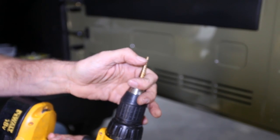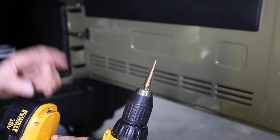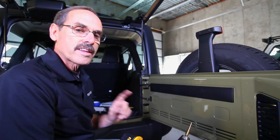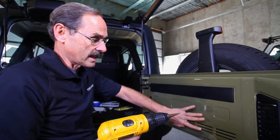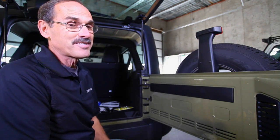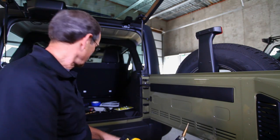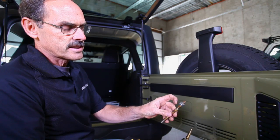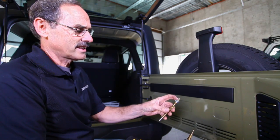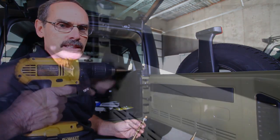Next up we'll drill our pilot holes for the nutserts. I'm just going to use a step bit that will give me about an eighth inch hole just to get it started. One thing you do not want to do is get overzealous with this bit and go through the first layer and have it punch through and hit the back side, because when it hits that back side it'll put a lovely dent in your tailgate. This step bit has a stop in it to prevent that. For our final drill, I'm using a drill stop I bought at the hardware store for about two bucks — put it on there so we won't go through and do any damage.